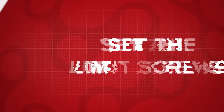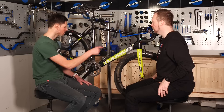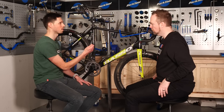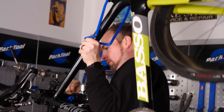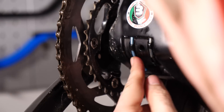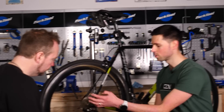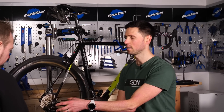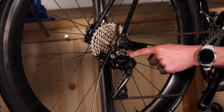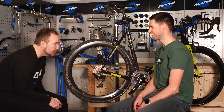To help speed things up, we need to get the section underneath the bike to run through the frame how it was when we hooked it out from under the bottom bracket. We'll pivot the bike up again and slide the cable all the way through. The next thing is to reassemble the last section of housing, attach the inner cable to the derailleur, and then move on to setting up the derailleur indexing. But first, we should check the limit screws of the rear derailleur — making sure the top pulley wheel is in line with the sprocket. Looking from the back — yes, it is in line. Fantastic.